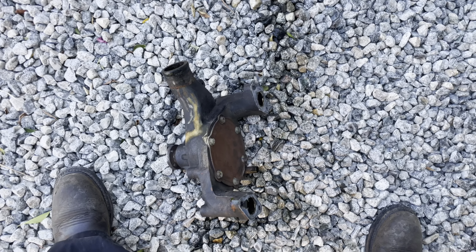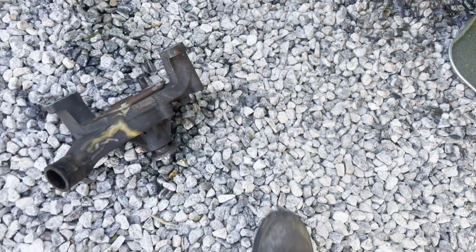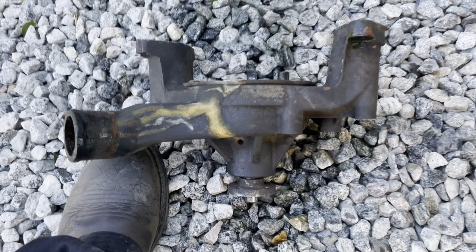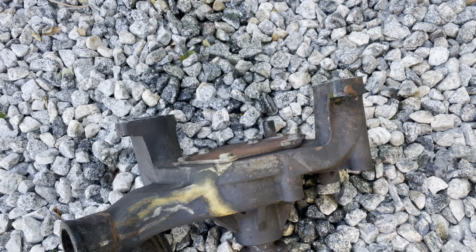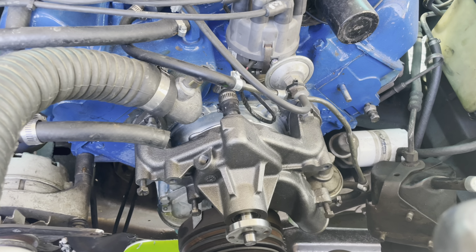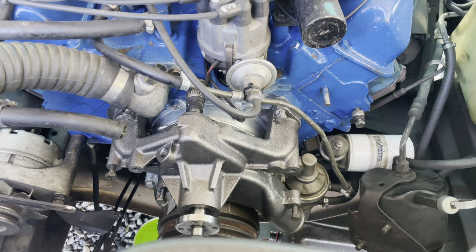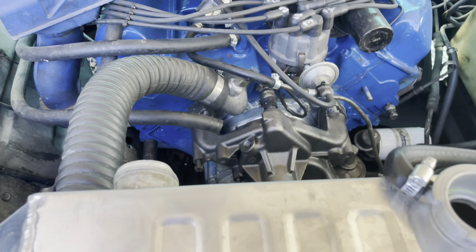And, well, that's dripping out of the weep hole. Look at that. Well, it was done either way, but could have at least looked at that and noticed that prior, because that trail's been there a while. Yep, definitely a trail. New pump is lined up. A little bit of silicone on the gaskets both sides, silicone on the bolts. Tighten that down. Start putting our accessories in.